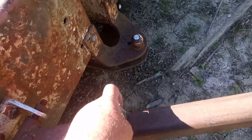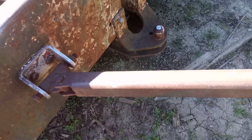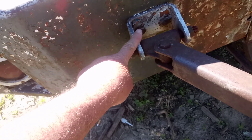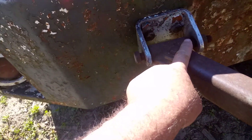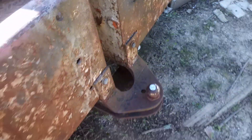Once you have the rubber, you're going to start off with some trailing arms. You're gonna have to have some steel box tubes — looks like two-inch square tubes, and it's pretty thick too. Then you're gonna have to have some brackets that bolt up to the back of your truck, with two ears on them with holes in them for the bolts, so the arms can go up and down.